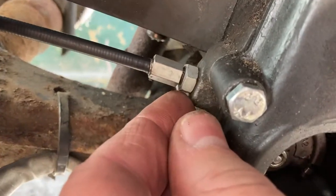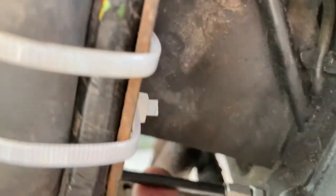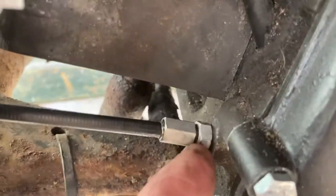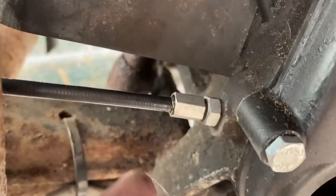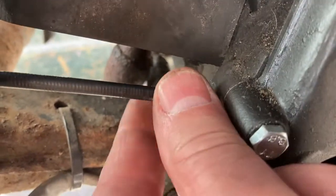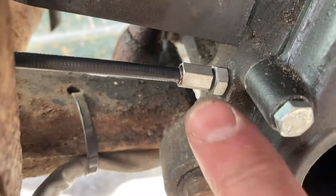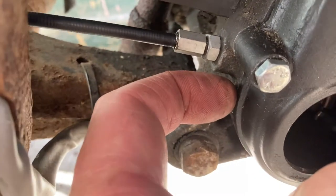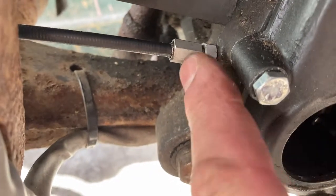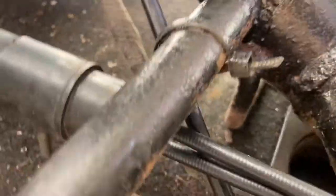Couldn't make an adjustment for the oil mixture on the two-stroke. So I took this adjuster off the other Piaggio from London — still in great condition. There was a broken-off bolt still screwed into my engine cover, and I thought I'd never get it off. But oddly I just got a screwdriver in the end of it, started to turn it thinking it would never work, and it just turned and came straight back out. That meant I could put a new one in once I'd fitted the new cable.